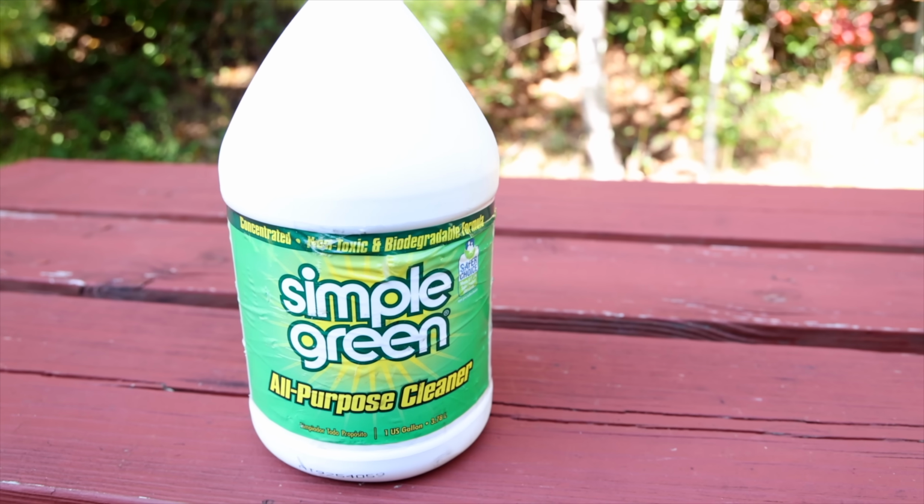In regards to what I'm going to use to clean it, I'm going to use Simple Green. I've done a lot of research on this and things like Murphy's Oil Soap or Gabe's Pride. Other various cleaners. I think Dicor actually makes a cleaner for the roof. Again, it's not rocket science, just a good cleaner that's not going to damage the roof. Since the roof is rubber, you definitely want to stay away from anything petroleum based. But again, check with your manufacturer and see what they recommend for cleaning. I checked with our buddy Todd, who is an RVIA Master Certified Tech, and he said Simple Green is fine. He said really any of those that I listed are fine, but we're going to use Simple Green for the simple fact that I already have some.